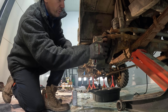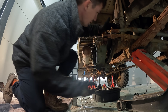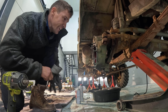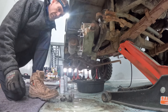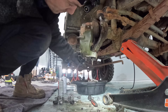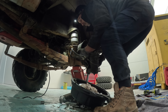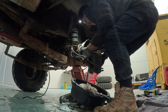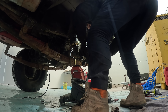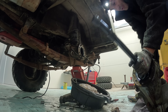The brake drums are set. Now I need to learn how to take this front hub apart — I'll probably start with the steering linkage, then the top and bottom kingpin, and the brake lines first because they're a bit more delicate.